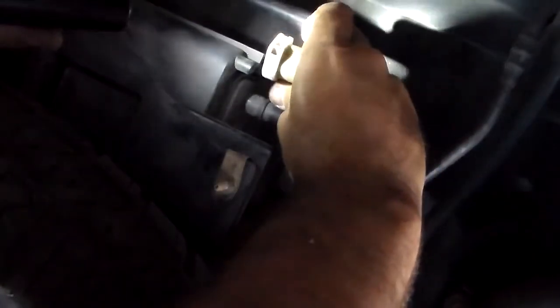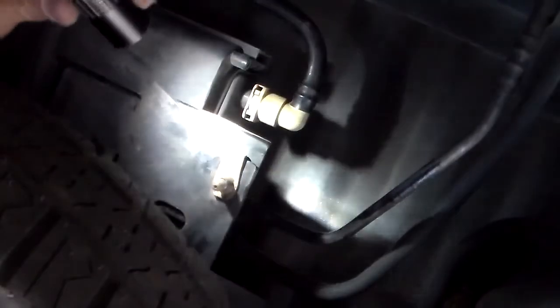Put your tube on. Make sure the trash ain't around it, the inside is not full. It's just a push-on. It has a finger push-in tab — you push it in and it releases these two tabs right here. See how they spread out — that's how you just pull it off. When you go to put it back on, you just line it up straight, push it on, and that's it. Tighten this down — this is a 13mm.